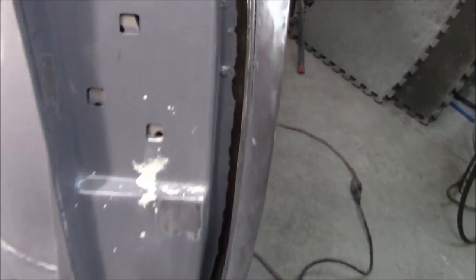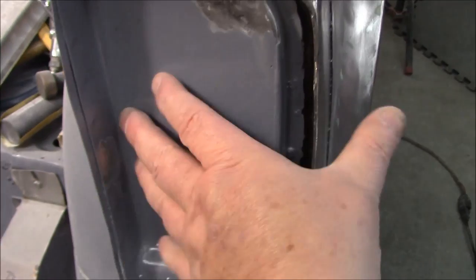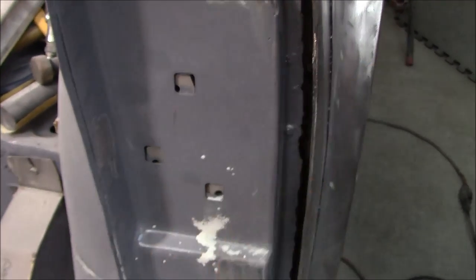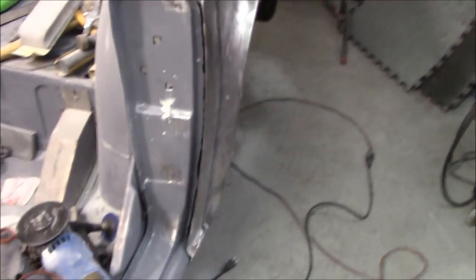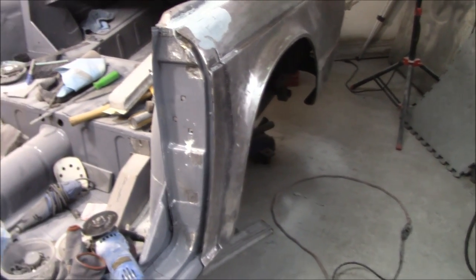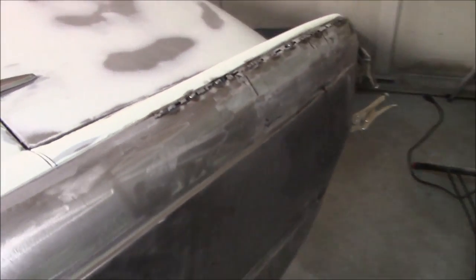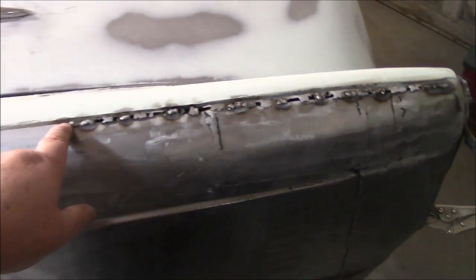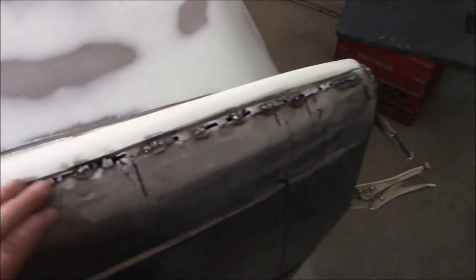I'm planning on using that steel rod here on the inside of the A-post. You can see how ragged this edge is - looks like it was cut with a blowtorch - and there's quite a bit of a gap between this edge and the fender lip. I plan to weld in some rod along here to make that look better. The welding is far from done on this car. We'll continue with filler work on the rear and stitching this fender as a break from sanding.